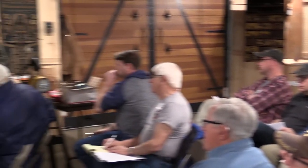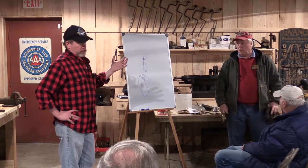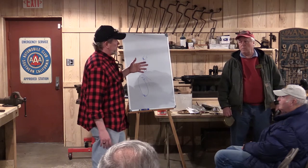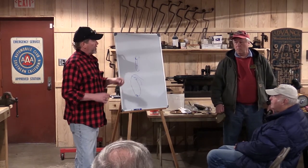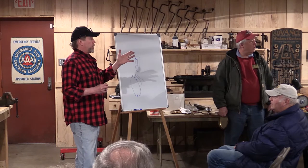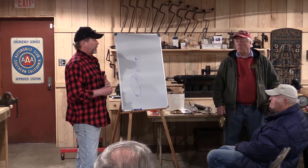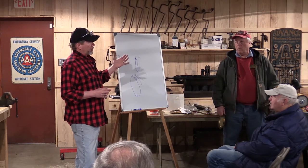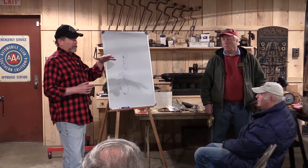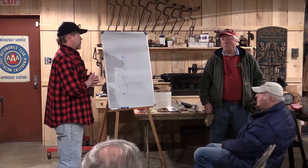We also brought a product by Rio Grande — one of Harris's competitors — that's a gold-toned silver solder. You're going to put a whole lot more heat into your parent part and into the solder to get that seal to happen. What I noticed with the Rio Grande gold is that it has kind of a cauliflower texture once it lays down — it doesn't puddle. Whether that's a good thing or bad thing, I'm not sure.